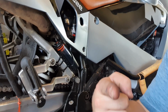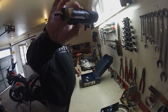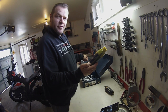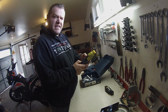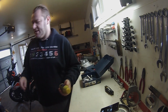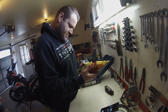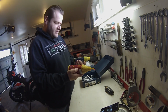Let's get to the 390. We'll have a look to see what we've got first. We've got the Scotoiler itself. Some blue chain oil stuff. Those are good for 0 to 30 degrees, which is actually pretty much all that it gets in New Zealand. You can get a red, which I have as well. And that stuff runs from, I think it's 20 to 40. So where I'm anywhere, this is good for summer and this is good for winter.